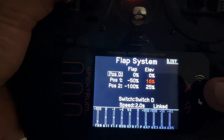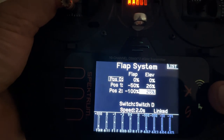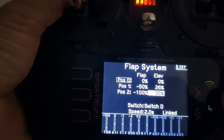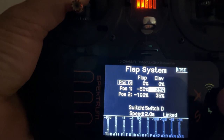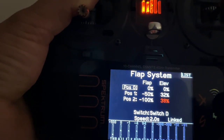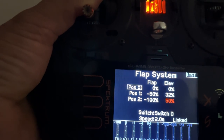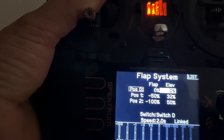In this video I'm going to show you exactly what happens when you get it wrong. The default was 16 at half flap and 25 at full flap. I changed it to 26 and 35, and the plane just really went for a nose-down attitude after that. So I thought, let's give it some more — and we went with 32 and then 50.